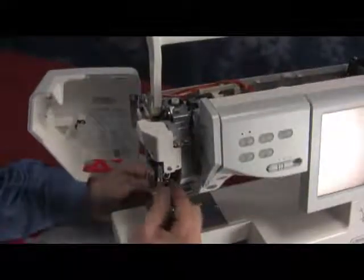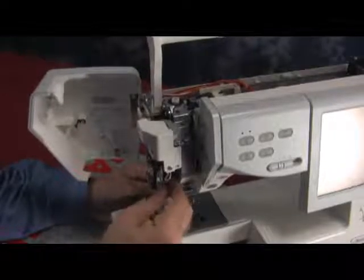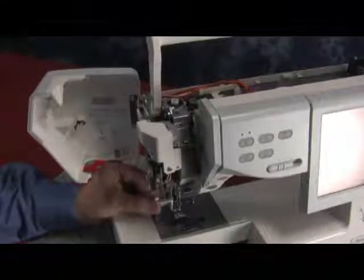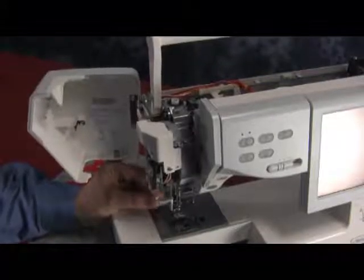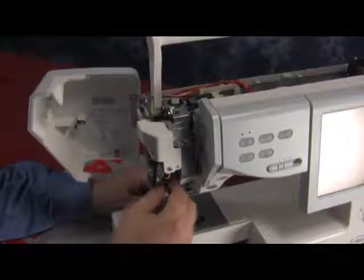Now, once you have put the threader motor back on, you want to test it to make sure it's okay. Start to turn the black screw down in order to lower the white plate with the red arrow on it. You can see that it only has a little bit of wiggle. It does not move up and down freely by itself.